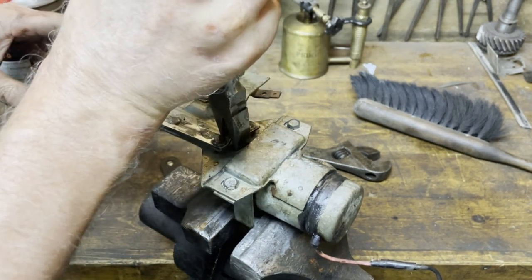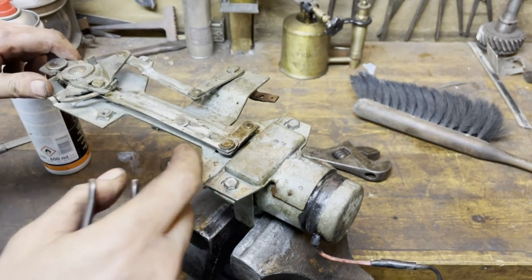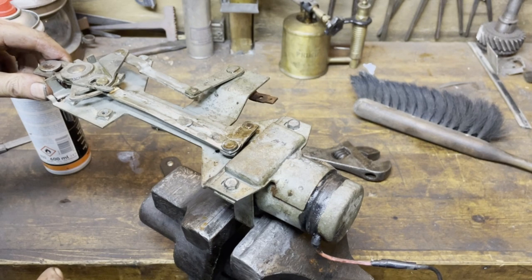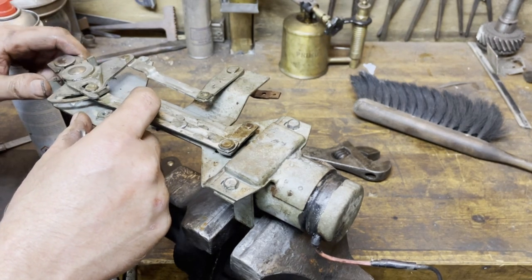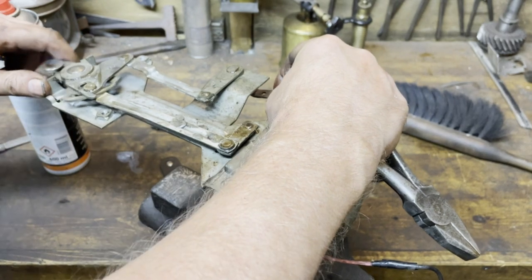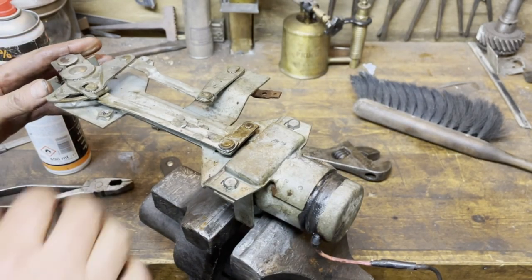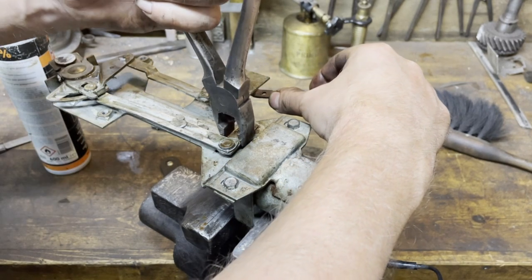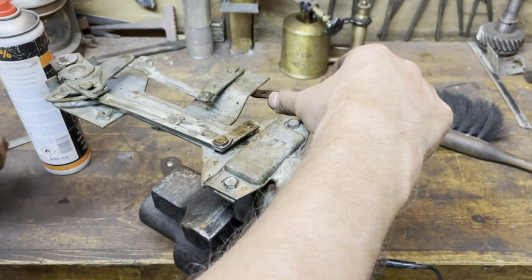Now let's see. Now with the mechanism, with the solenoid, it's still not in the bottom there. Now it is. And here it doesn't open anymore. So this is the position it would be in when we are driving, and you cannot open the door. And then when we are in a park position, it will open.